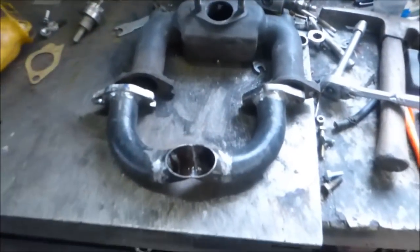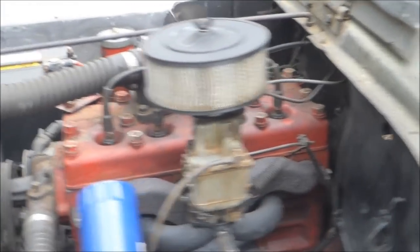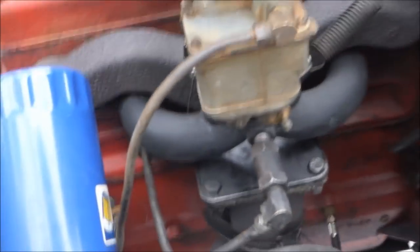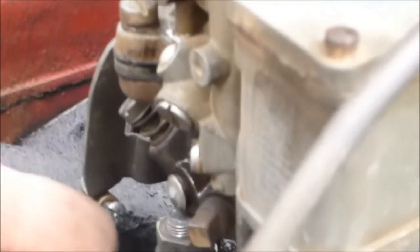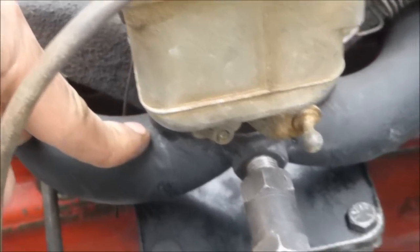I just need to make that carb flange and then I'll show you more when it's done. It's all done and running good. I had to put a shorter air filter on it - it's a little bit taller than the ones I had stacked on it, so I put just one on there and it fits better under the scoop. The PCV is all hooked up - I welded on a nut with the flange, and for the studs I threaded the flange and welded it on the backside.